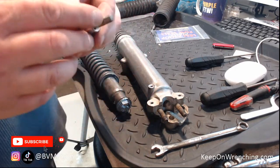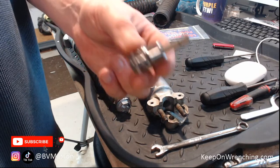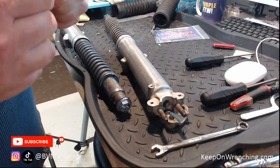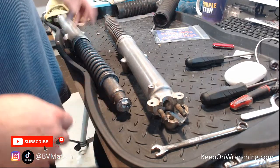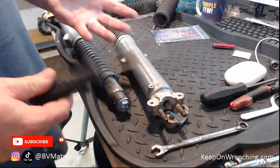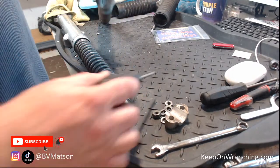I went and bought a special tool right here to take these out because I thought that they were like a 14, no, a 6. Looks like it says 6 on it. A 6 millimeter. But it's not. These have JIS. So what I'm going to do is grab my JIS screwdrivers. Do not put Phillips screwdrivers in this stuff, guys. You'll wreck it. You will wreck this stuff.